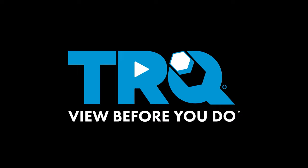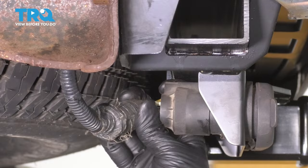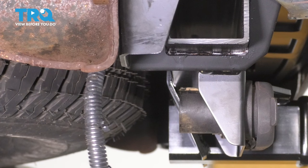On the trailer hitch, let's disconnect the wiring harness off of the trailer plug first. To do this, there's a locking tab on the back side at the top here. If you press it and wiggle this out, it should pop out. A lot of times these are full of sand and debris because they're out in the open on the back of the truck. So if it takes a little bit of effort, that's normal. You can also spray rust penetrant — that'll sometimes help. Looks like this one came off pretty easily, so that's good.